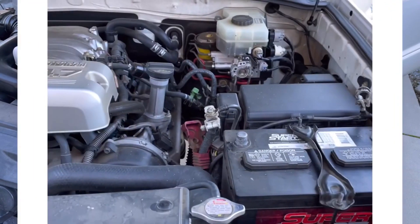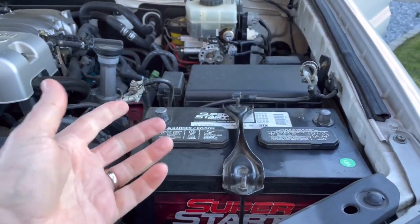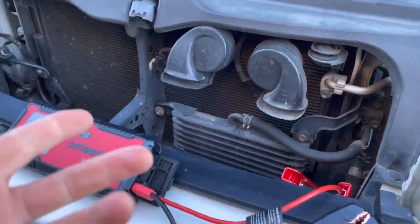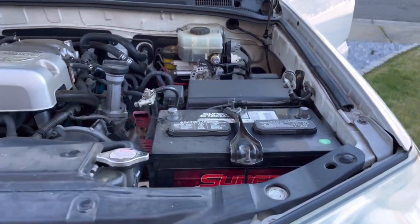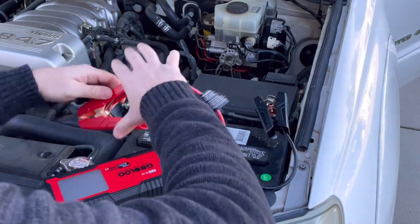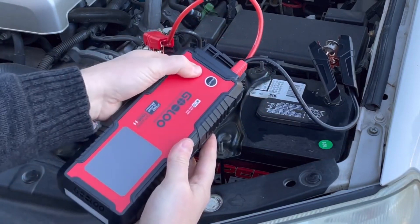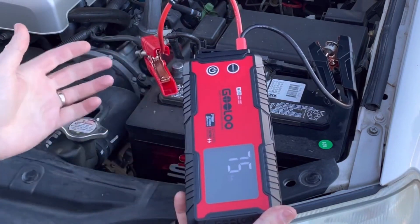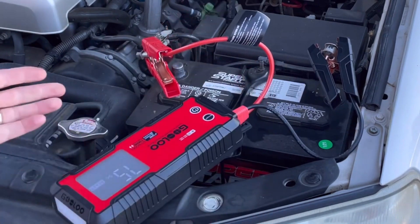Here's a scenario that actually happened to me — someone came and asked me to help jumpstart their vehicle, and their battery had actually been stolen. So all there was were the terminals. I don't actually recommend doing this, but in case of an emergency or as a last-ditch effort, this can possibly get you to a store or at least provide heat or AC if you're stranded. Hook it up like normal — negative onto the negative terminal, positive onto positive. Now it doesn't actually read anything because there's no battery to read. So you have to turn the unit on and then put it into the ready position by hitting the boost mode button, providing the full use of the battery since there's no other battery to help provide a jump.